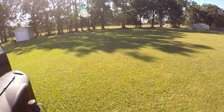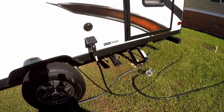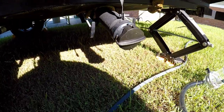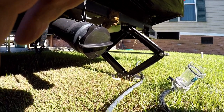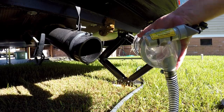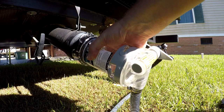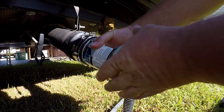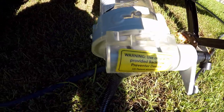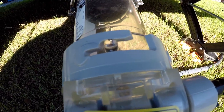One of the things I really like about the Mallard is that it sits up a little bit higher than the Class C does, so I've got a bit of a higher playing field here. This is my clean-out valve here. So you just take the top off — here is the system itself. You've got the water-pressurized cap. I bought this clear cap because I wanted to be able to see when the tank was clean. You put it on nice and snug, you've got your backflow preventer here, and your water-pressure valve here, which puts 15 PSI into the system.